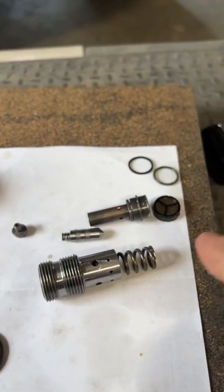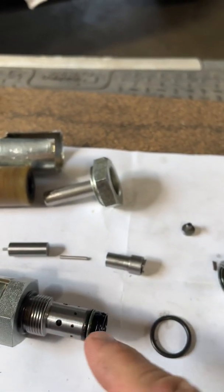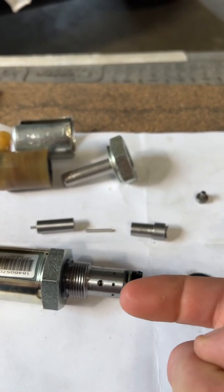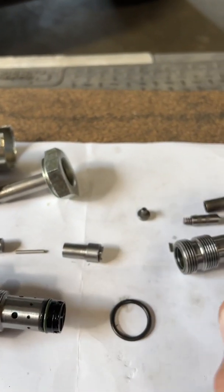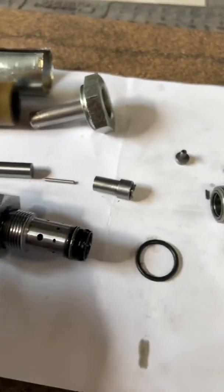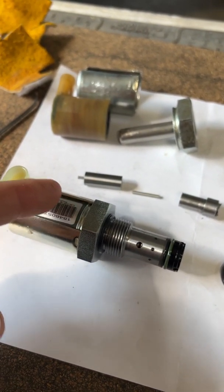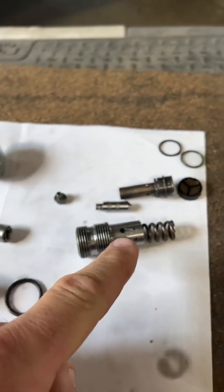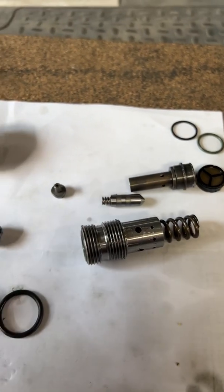Closing the shuttle valve forces oil through tighter holes that create your 500 PSI for your injectors to fire and start the truck. Oil comes in from the high pressure oil pump on this side, and the IPR does all the shuttling around to boost that pressure up. At idle, when you turn the key on, 12 volts goes into this solenoid valve electromagnet, shoves everything forward, closes off your drains, and forces high pressure oil to your injectors to fire them.